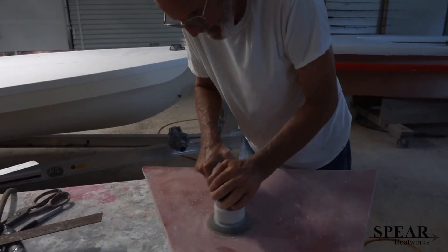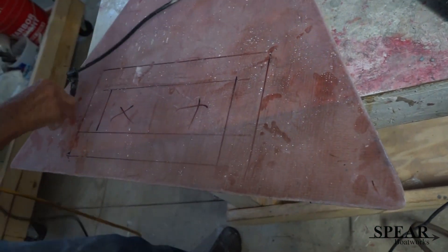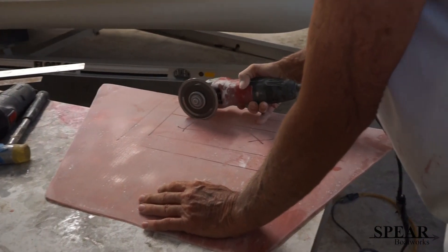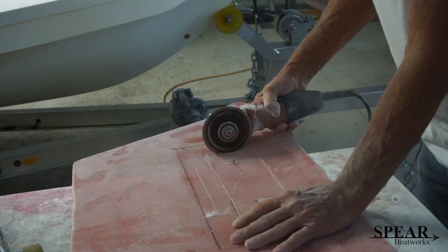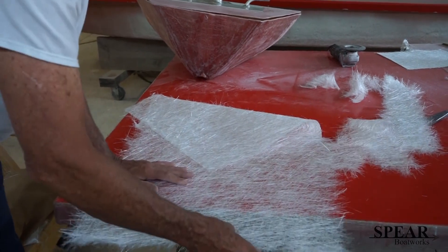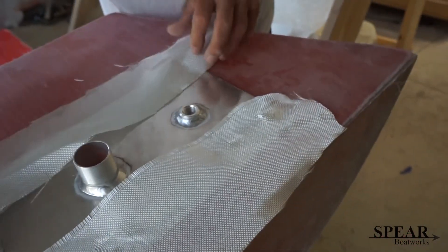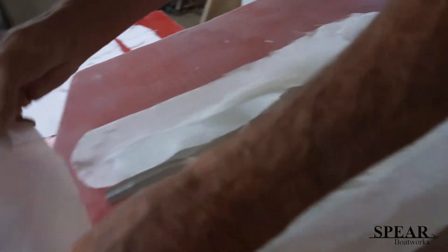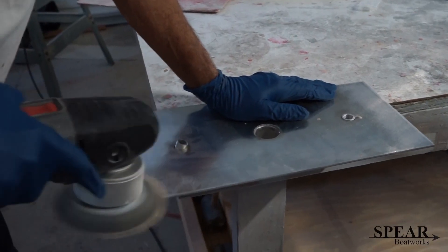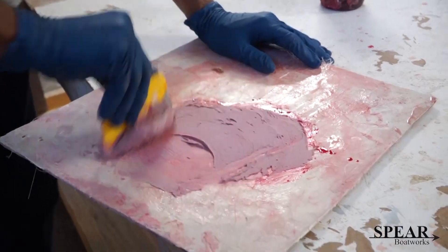I'm sanding this all off before we put it together. Making the pattern — that's the only aluminum that's going to be in the tank. I cut it two inches from the outside edge. I'm using a diamond cutoff saw on a side grinder — it's just got a diamond edge and I'm trimming this out. Tearing mat, getting ready — this is all going to get glued down first. I'm just pre-cutting everything and getting it fit in place. Now I'm sanding this so we get a good bond. Everything needs to be sanded before you put it together.